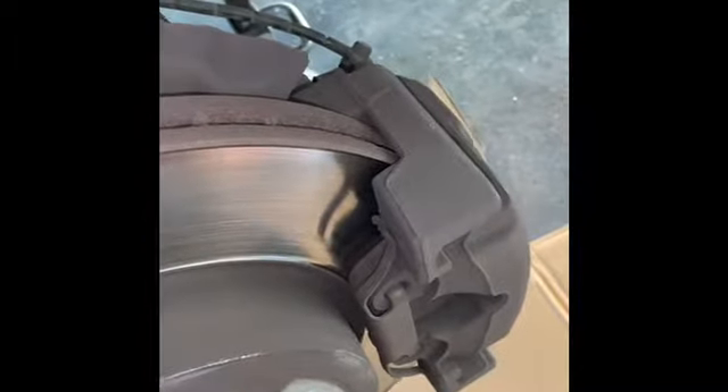I think it's a six. Then you're gonna want to get back here and knock off this dust cap — this cap right here. And then you can feel it's like another Allen wrench in there to take that off to get the sliders out. And then there's another one down here at the bottom you're gonna want to take off. You're gonna take off these two bolts, and then the whole caliper will come off. Then you'll be able to get the pads out and pull the rotor.